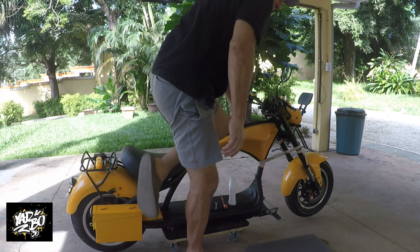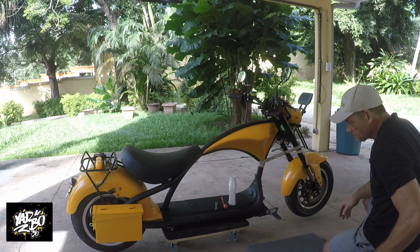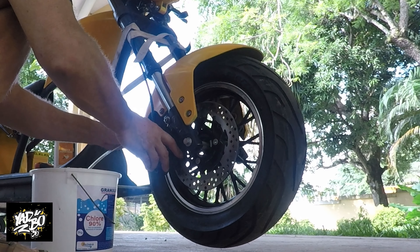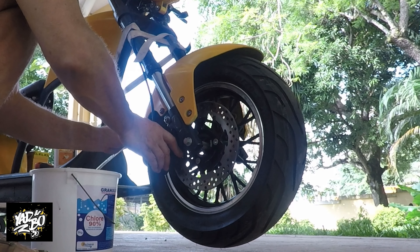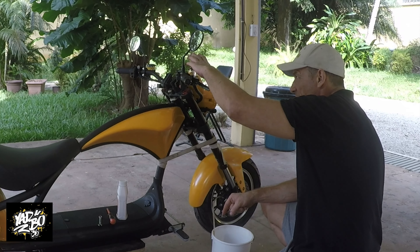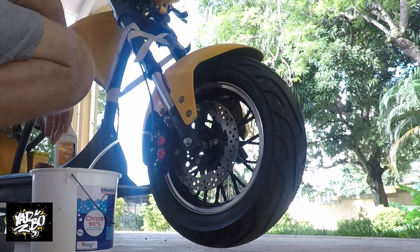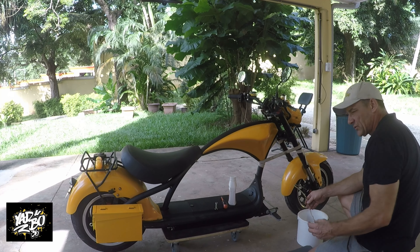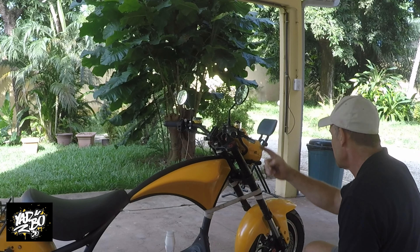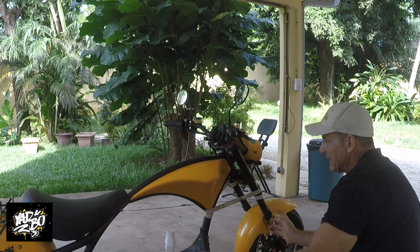The way I'm doing it is one way — there's another way. I'm pulling the brake fluid in here and draining it through the nut valve. You could also use a syringe to push the brake fluid in and push the air upstream. It's fairly fast, but the thing is, if it spills over here, you might have a mess.